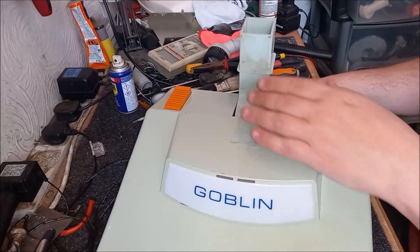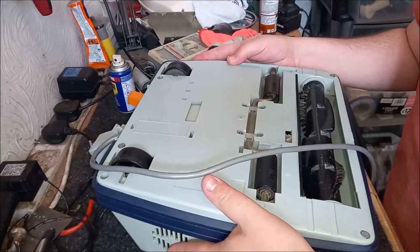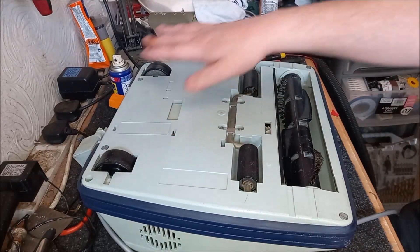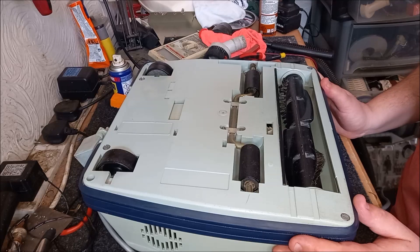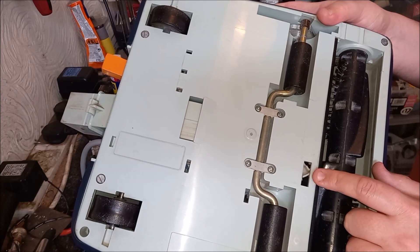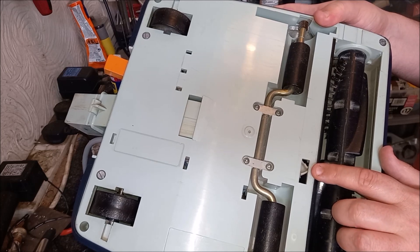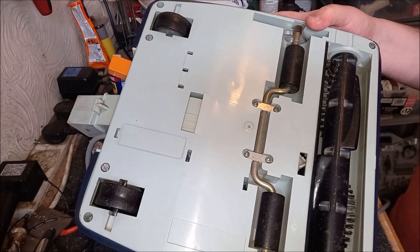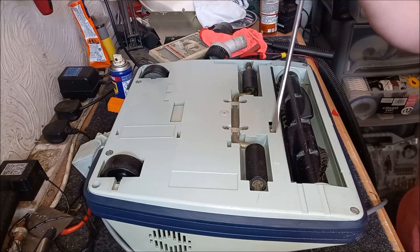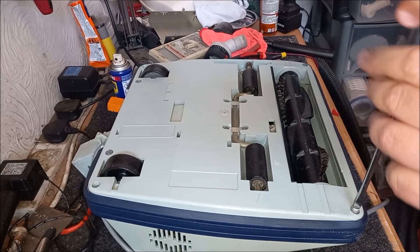Let's flip the machine over so we can get to the underside and take the hood off. It's very simple on this cleaner — there's four screws. Interestingly, on this model you'll see there's a two-speed switch, so when you put the tools in it boosts the power of the motor upwards, giving you more suction and more airflow. On our later Housemaid that we've seen previously, we don't have that, as this machine uses a pan converter whereas our later one doesn't. I'm just going to take out these screws.